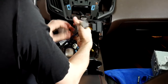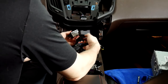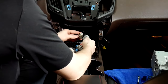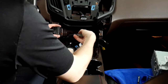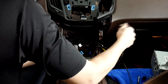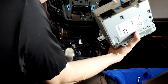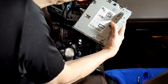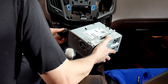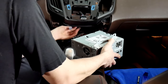We have the radio out. Right here is our power cable. Take the male side — the vehicle side — and plug it into the female side of the harness, just like that. Then lock it so it should not come loose. Same with this plug right here — do the same thing. These two ends are going to be the new ends going into the radio. We're also going to be hooking up a USB — yours might look different than the one that comes in the packaging. Plug it into the spot where we unplugged the USB, then go ahead and plug up our power and make sure it locks in place. Let's get our video signal set up as well.